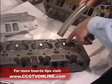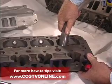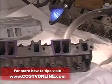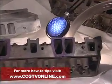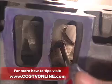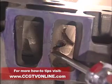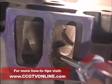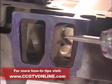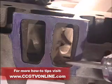I'm just going to put my plastic tube into the valve pocket in the combustion chamber so we can suck all the dust out while I'm working on the port runner. I'll tip this up. Now I'm going to bring the lamp down here and shine it onto the tube, and that sends light up through the port runner — I can see a big piece of casting slag down in there that we're going to have to get out. That's really going to cause a lot of turbulence. The object of opening up these ports isn't to make them bigger, but to clean them up, cut down on turbulence, and allow the air to flow smoothly, because air doesn't like to turn corners or go around obstacles. We'll open all this up in here and clean up all that slag.